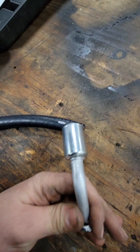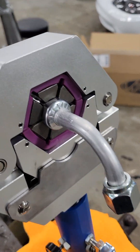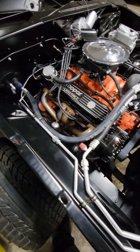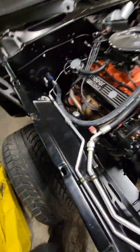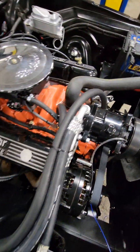Make sure you mark it before crimping because it's not movable afterwards. I put mine in a vise so I could clamp onto it — this works just like a hydraulic brake flare tool kit. The rubber tape goes over these fittings. Now the AC lines are installed completely. We route the heater core hoses along the side of the AC hoses. This is a one-way valve. We run this connector through a hole in the firewall.